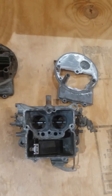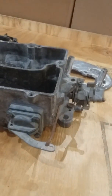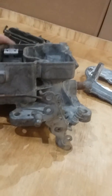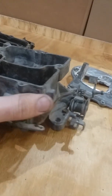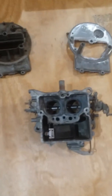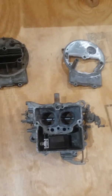I'm putting two of these 350 CFM carburetors together for a 300 with the LS head that I'm working on. I had the carburetors, so I figured I'd just use them rather than buying new ones or buying Holleys. So those are a couple of modifications you can do if you want to run Motorcraft or Autolite 2100 or 2150 carburetors.